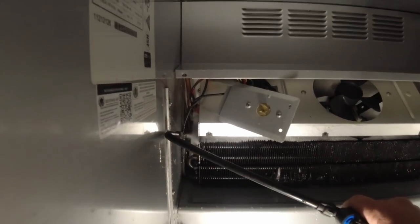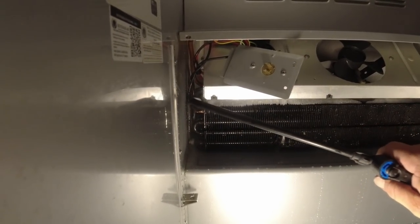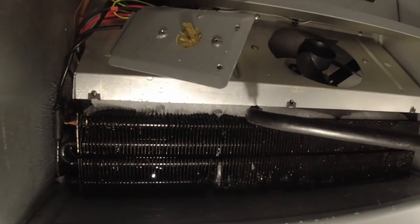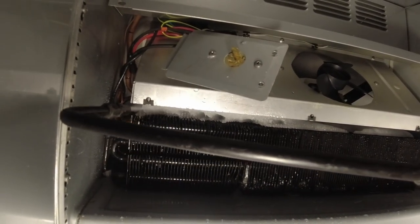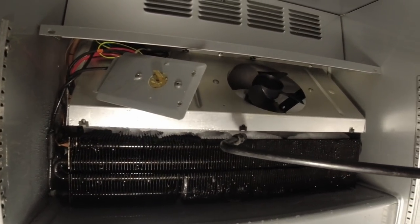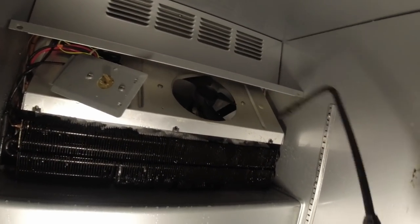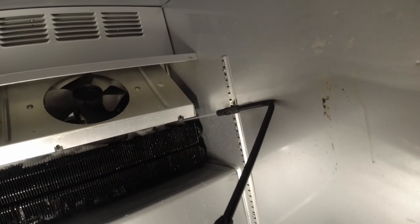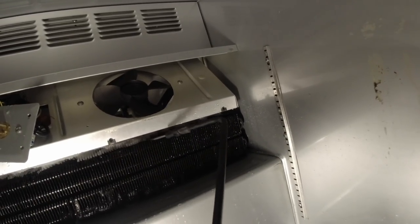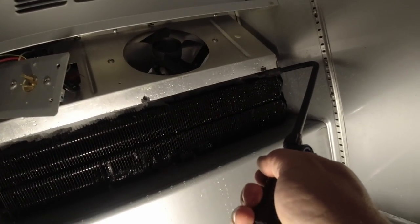One of the things to watch out for: you can't use a torch if you've got R-290 or any flammable refrigerant, and you also can't if you've got electrical wires in there. Honestly, this melted a lot quicker than the torch does. It makes a bit of a mess, but you're going to melt water with the torch anyway, so it's just easier with the sprayer. We'll probably find a leak in the evaporator, and I guarantee the condenser coil is plugged solid — it's right beside the fryer, which is a horrible place for it.